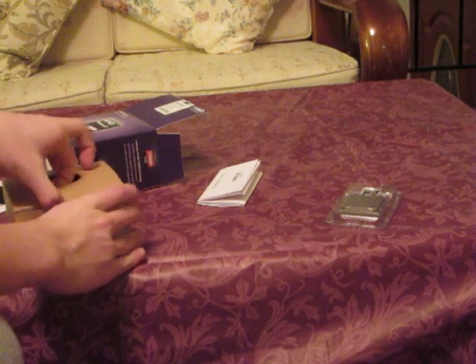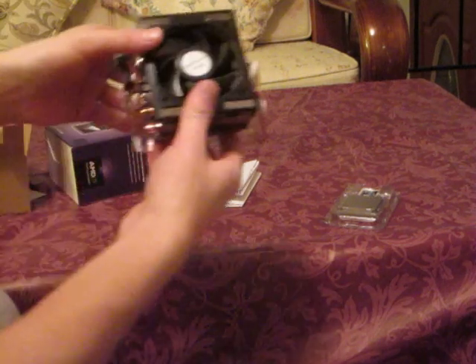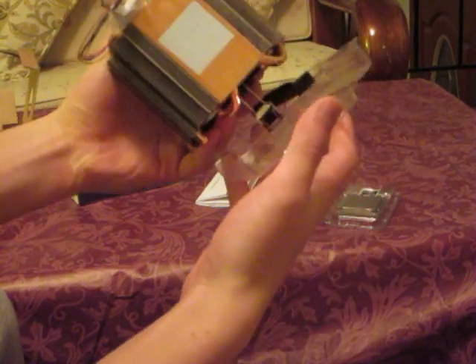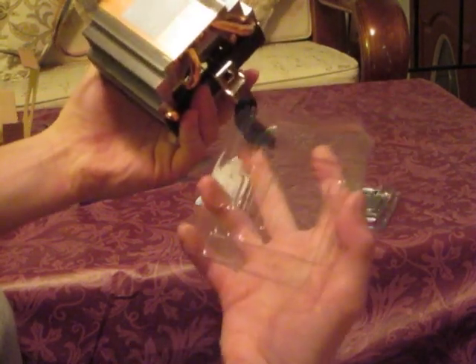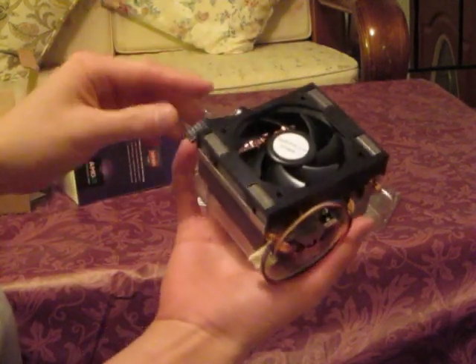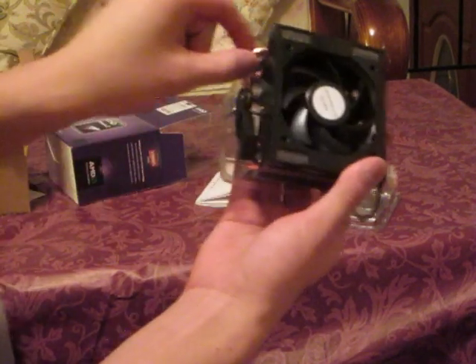The X4's are faster if you want them at the same price. Here's your standard heat sink — it's got 4 heat pipes actually, so this is not too bad of a heat sink. It's on a 60mm fan with copper heat pipes. These are actually pretty thick — I would say these are 8mm heat pipes.